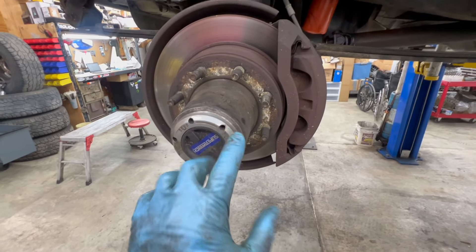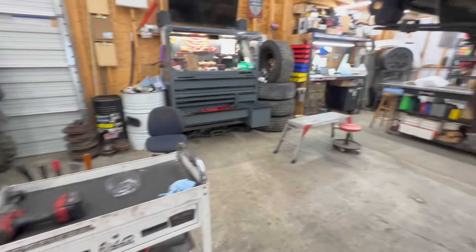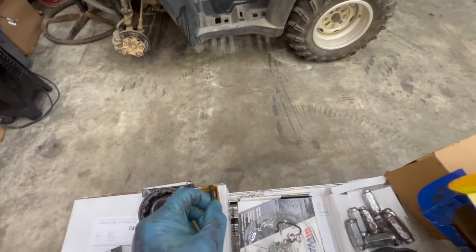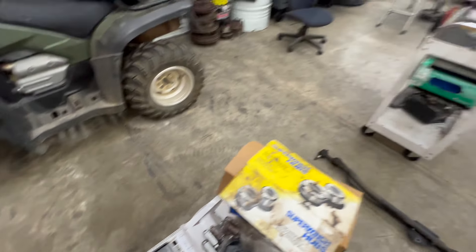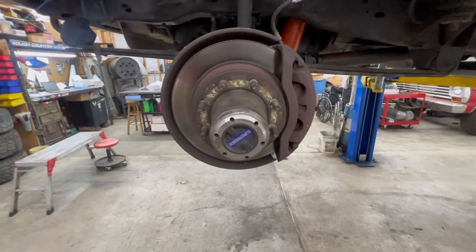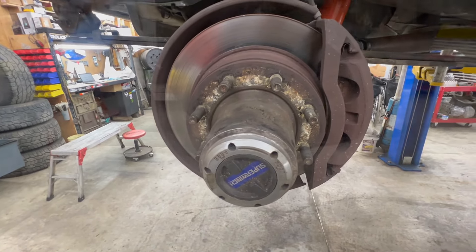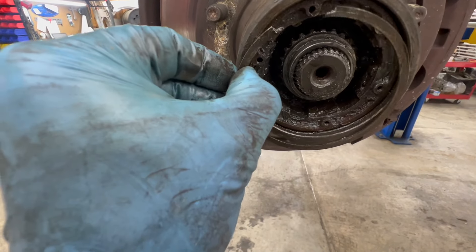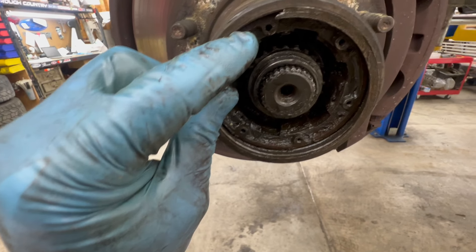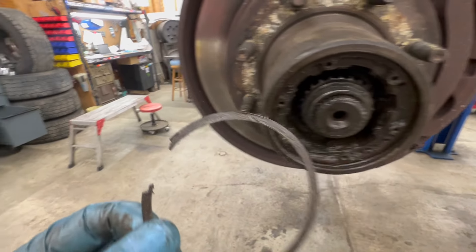He has the Super Winch manual locking hubs on this truck, and it's just as simple as pulling these little bolts out right here. This is the thing that's going to kind of differ from truck to truck — are you running factory automatic hubs or some form of aftermarket hubs? So we pulled all those bolts out. Now you have this large locking ring to remove out of here. What I do is take a pick and just get it started and kind of pry it down, then you can get a small screwdriver and work it out over this lip and pull it all the way out.